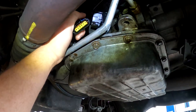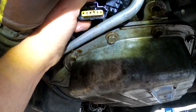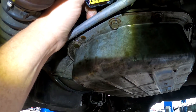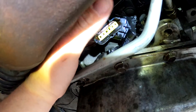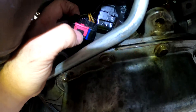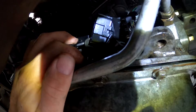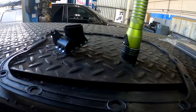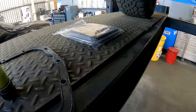This truck is having some lack of power issues, and one of the things I found was hydraulic fluid throughout this connector. I'm going to do my best to clean it out using contact cleaner and letting it drain. The risk is I may have to run an overlay or jumper harness for the three wires in here, even though it's a six-wire capacity connector. I'll also have to replace the range switch. So we'll replace the pan gasket, the range switch, and also put a new filter on it.